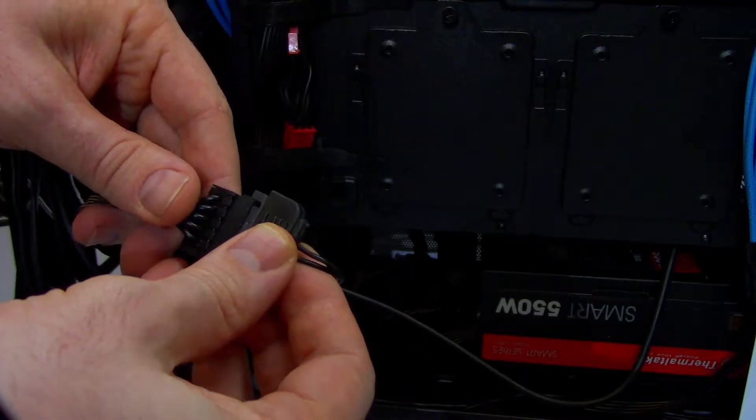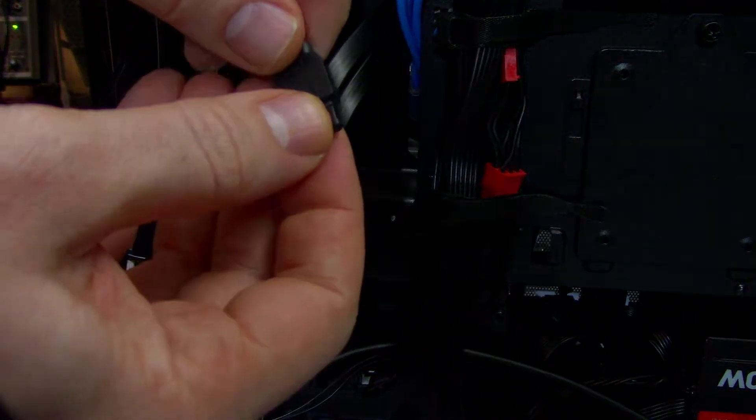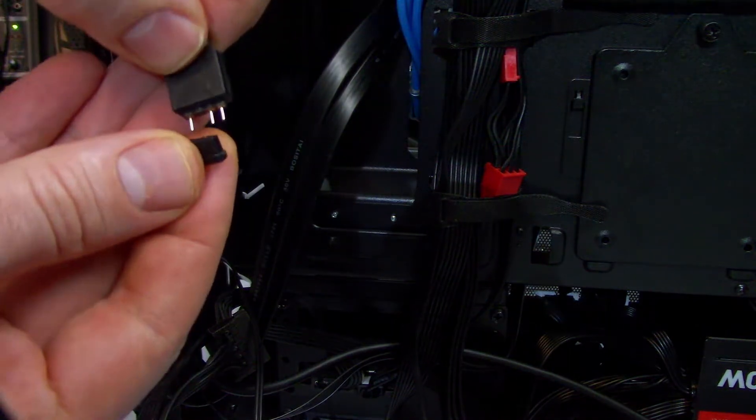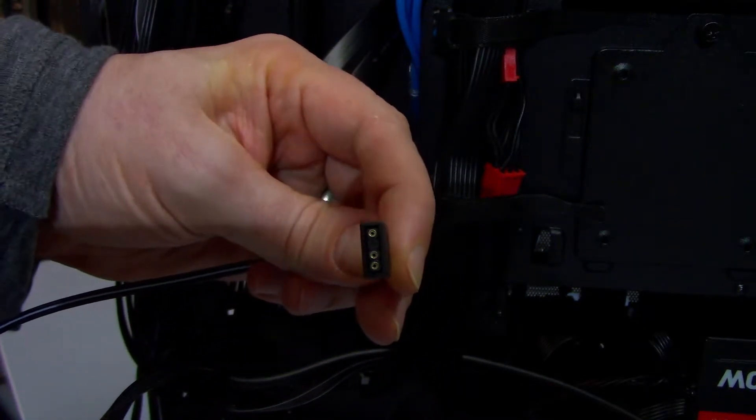It is a few days later and I did get some help building the test system. The ARGB hub is built into the front IO and is powered by SATA. The ARGB connectors on the fans are not standard 5V ARGB connectors, so you cannot easily use them in another case without a Lian Li ARGB hub or an adapter. You can add extra LEDs using the extender connector, but for multiple LEDs you will need a 3-pin 5V ARGB splitter. There is also a connector that plugs into the motherboard to allow the motherboard software to control the LEDs — this hub only works with 3-pin 5V ARGB LEDs, so 4-pin 12V LEDs are not compatible.